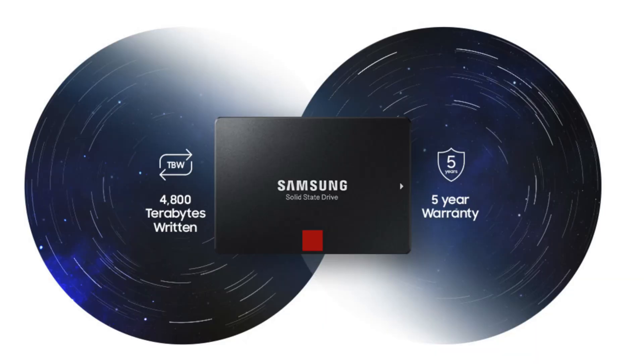Over the years SSD technology has come down in price and improved in performance. We've now reached the point where a 2.5-inch SATA 3 SSD — like the one we'd use in the MacBook Pro 2012 — physically can't be pushed any further, as we've hit the maximum throughput of SATA 3. I've bought myself the Samsung 860 Pro, the fastest SSD on the market for a SATA 3 connection — possibly a little overkill at £90, but far less than the $400 option in 2012 and much better technology. It can have 4,800 terabytes written to it before there may be a problem, so it's covered for much more than your average Mac user.